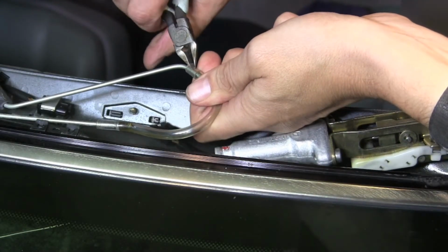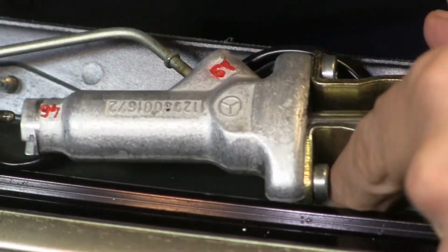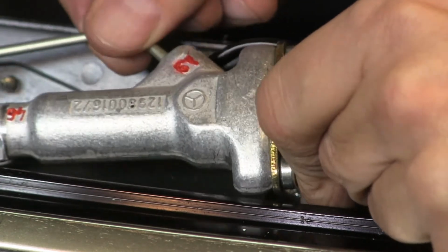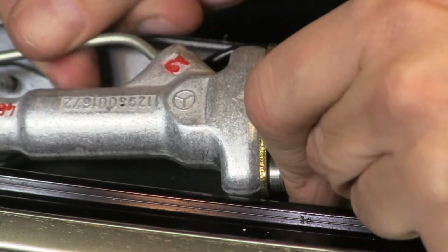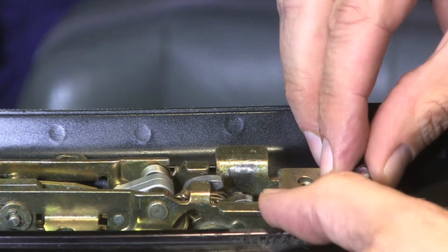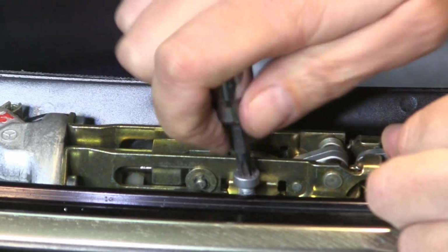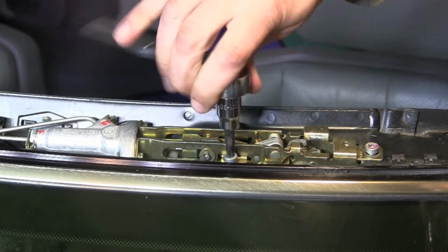I'm ready to remove the plastic tubing that has kept the hydraulic fluid from leaking out, and then I'm going to position the hydraulic ram cylinder where I can put the steel lines in, and then I'll insert the clips and I'll use a pair of pliers to crimp those in firmly. Once again, a little blue thread locker isn't going to hurt as we put in our 3 T30 Torx drive bolts and tighten everything down firmly.